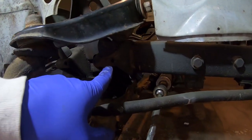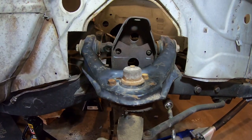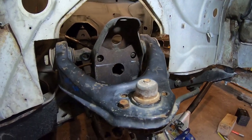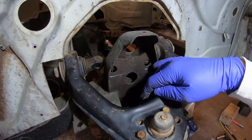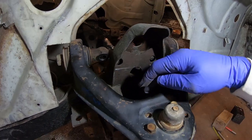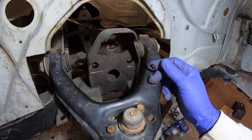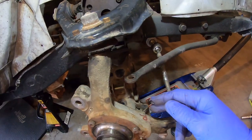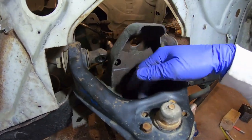I was originally thinking about cutting the bump stops off and moving them over and reusing them, but I'll just cut them all off and put them back on where they need to go. The other issue is there's not a lot of room here for a shock — this control arm just seems to be in the wrong place. Even if I shorten the lower control arm, it's not going to change this space. It seems too tight.